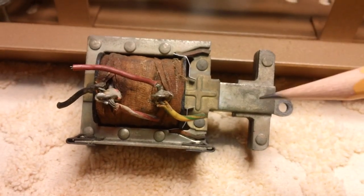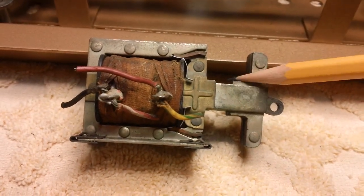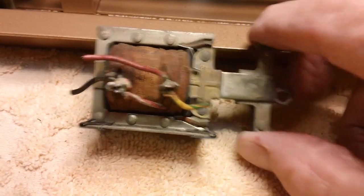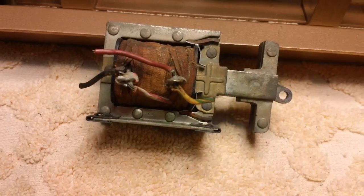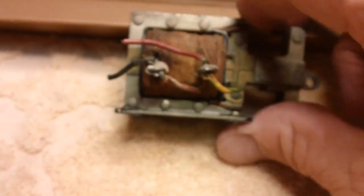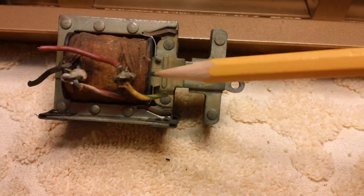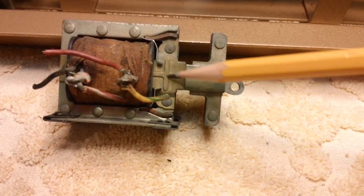I have to point something out here. This little deal, this latch solenoid, is really a complicated affair. It took a lot of brain power to come up with this thing. You just stare at it for a minute. You can't get it out. So if I remove this top rivet and bottom rivet that goes all the way through, how would it still come out? Because it's buried down in the coil itself. I'll get this camera to focus in. It goes way back in here and it's hitting on something. So even if I took this and this out, I don't know how that would come out.